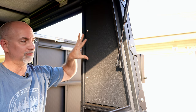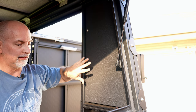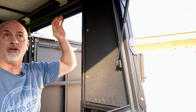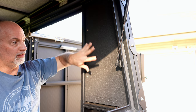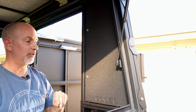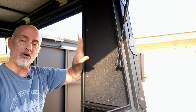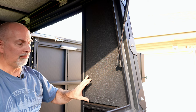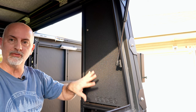There's an open hole right here where Goose Gear makes a panel that fits perfectly in this slot. All the electronics from the interior of the cabin — all the lights you see around the cabin — are pre-wired into this point, and the solar panels on top are pre-wired and drop right in here as well. I'm going to be putting the RedArc Manager 30 in with two 100 amp hour lithium batteries, and the RedArc control module goes here. The AuxBeam control module for lights, power, and water pump goes right here. Along the bottom we're going to put in USB plugs and auxiliary power plugs, giving us a complete power grid. Everything will be behind here with its own separate breaker as well.